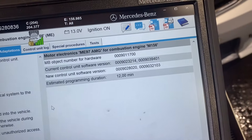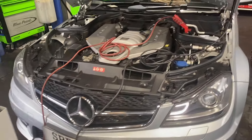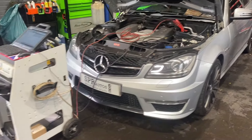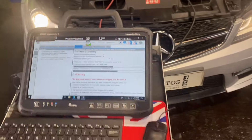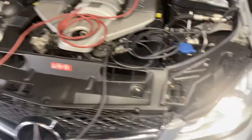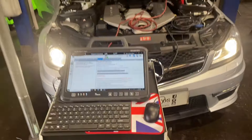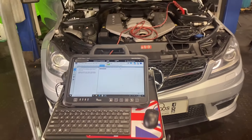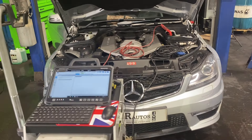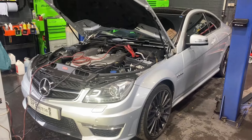We're all logged in on the diagnostic machine. We have got a software update which should detect it's not got factory software on it. Battery support unit is all hooked up so we can get that installed and then we should be back to factory. Software update is underway. Engine fan is going crazy, headlights are on and that's why it's really important to put your battery support unit on - it's taking 90 amps to keep that going. Programming's done. We are now moving on to coding and then we are all back to factory.